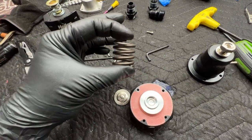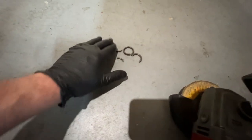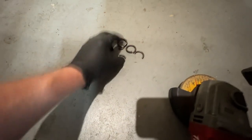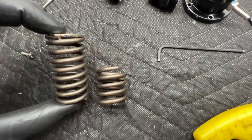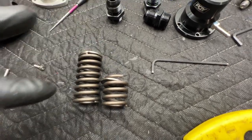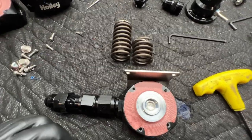Maybe I'll take a measurement of how high this is and take the other one apart and see how much we cut out. I cut out all of these coils — I went slow, so there's probably 4 whole coils if you add all those guys up. That's the amount I had to cut out of the spring to get it to have some end play, which I'm assuming will give me the 40 pound resolution I'm looking for.